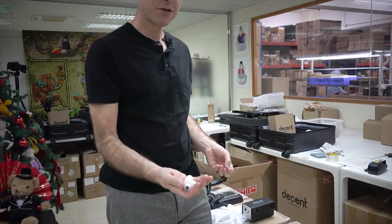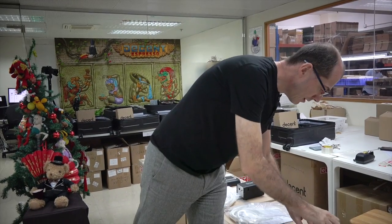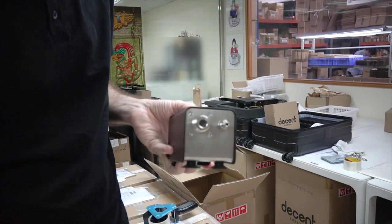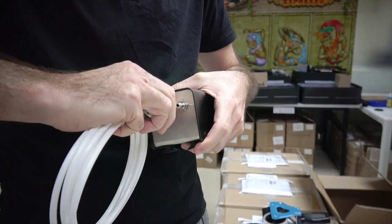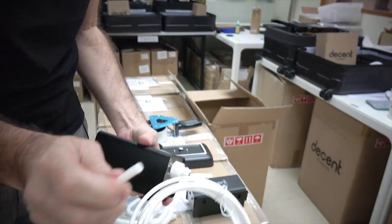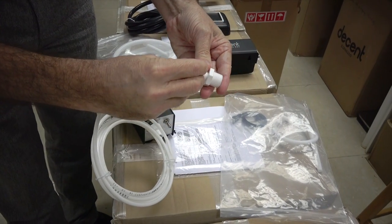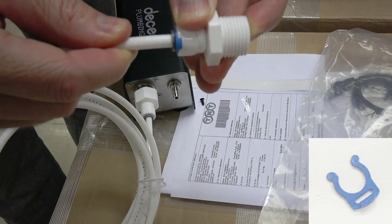We've given you both a male and a female version because we've seen both kinds all over the world. If you have any questions or a different kind of connector, please talk to us. You'll also find that we've given you a particle filter with a little rubber o-ring. The way this works is you're going to put that particle filter here like so, and then this tube is going to fit over the top of that. You might be able to just hand tighten it and not have any leaks, or you might want to use a wrench — it's up to you. This other end is going to go to your water supply. You push it through like so, then pull it back slightly, put that little washer over it, and that locks the whole thing in place so it will not pull out nor leak.